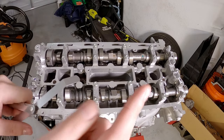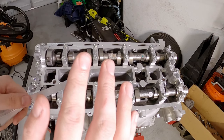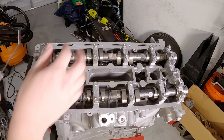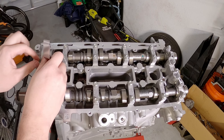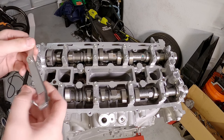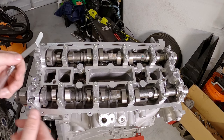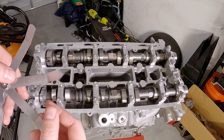Everything is back in place. Now let's see if my OCD attention to detail paid off. Hopefully I didn't screw anything up. The nominal clearance when I measure all of these should be ten thousandths. So we're going to start with these four right here, see what happens. I am nervous because I don't want to have to order any more parts. This one here's a little loose, but let's see the next size up — twelve thousandths. No, that one doesn't fit. So that one's right, we're good. Little on the loose side, but there is a tolerance, a give or take a little bit. So that's definitely within where it needs to be. That makes me happy.